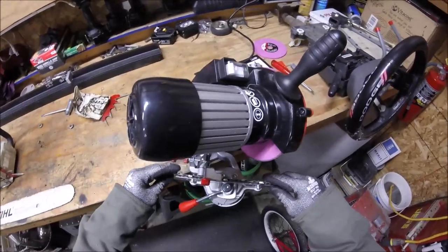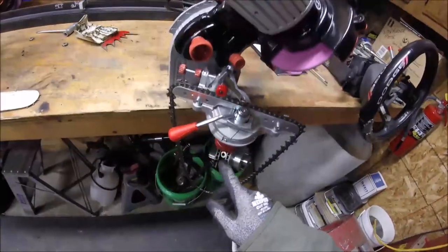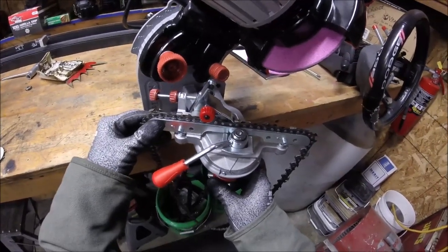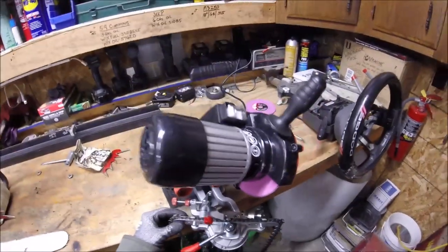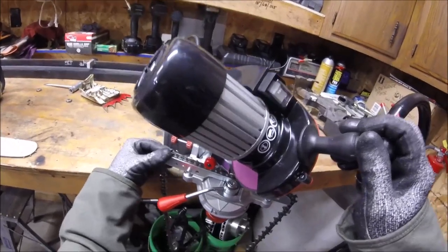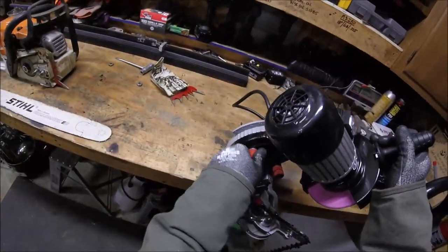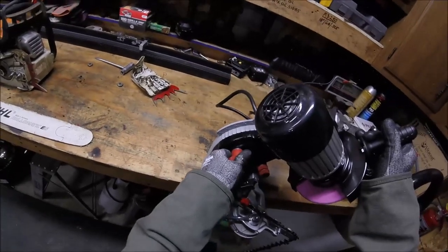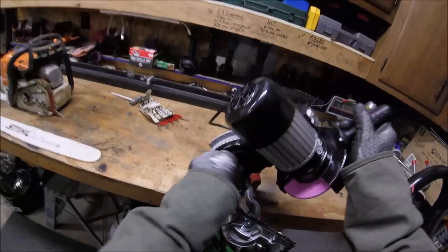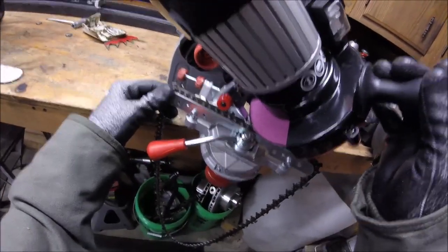Take your chain in there. When you do it, most of them are 30 degrees. Move your little deal there to 30. And then you got your adjuster. You're gonna wanna bring that back. See, that's gonna cut in there nice. And you'll set this. What I found, it works good. Put that thing right on 60. And that cuts in there pretty nice.